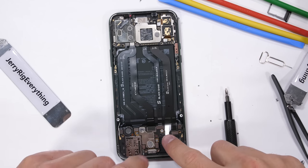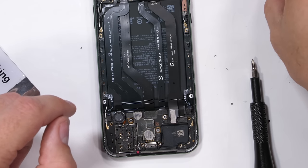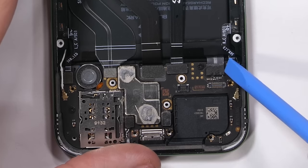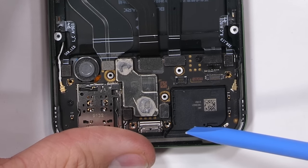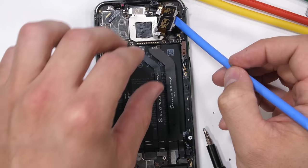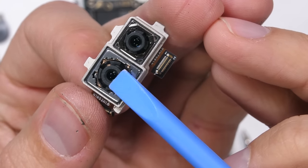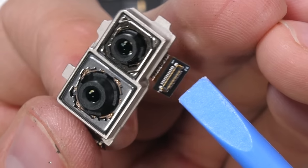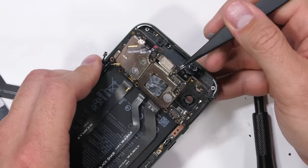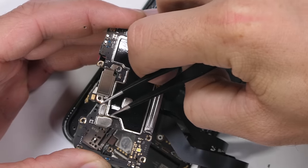As we go deeper, the rest of the phone looks like it was designed and put together by a caffeinated rabbit, with wires and ribbons all over the place. Nothing's really in the right spot. Not even the battery connector, which should be unplugged first — it's hidden underneath other ribbon cables. It's a pretty similar design to the old HTC 10, which won the least repairable smartphone award a few years ago. After unplugging a bunch of stuff, we finally get to the camera units. Both are housed in the same metal block: a 48 megapixel main camera with a 12 megapixel 2x optical zoom telephoto camera, neither of which have optical image stabilization. The top motherboard has two screws holding it in place, and then it can kind of lift out, but still has yet another ribbon connection and two wire cables attached to the underside of the board. Pretty complex.